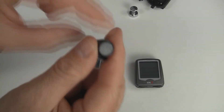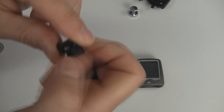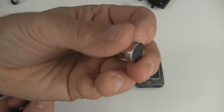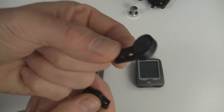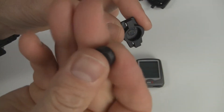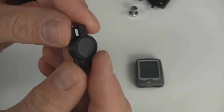For speed magnets, there are different versions available — we supply one version, but other bike manufacturers have different types and those will work too. If you lost your magnet, go to a bike shop and most any bike computer magnet will work. There are also a couple of versions of cadence magnets — our new ones, older ones, and third-party versions. One example showed the magnet had fallen out of the case. So when inspecting your bicycle, make sure there is actually a magnet in the magnet holder. If it's missing, there's no signal.